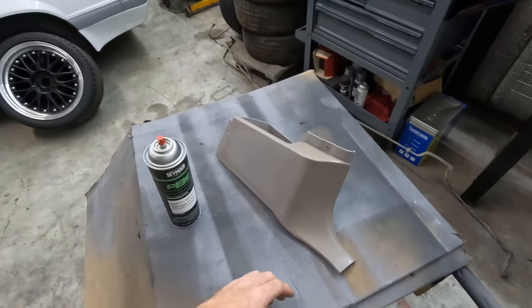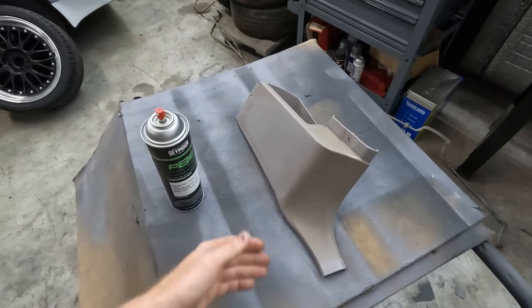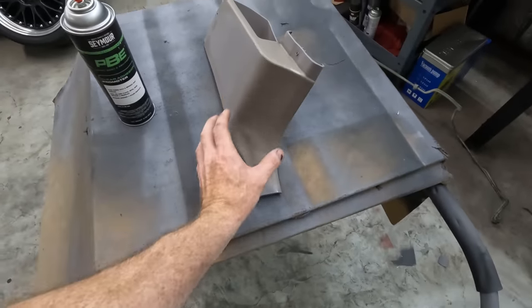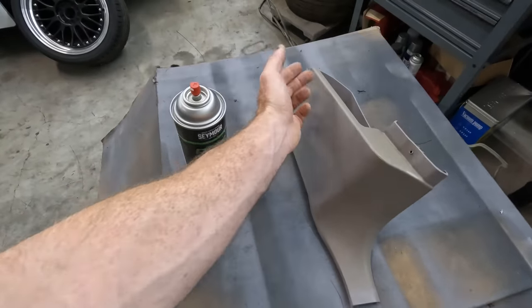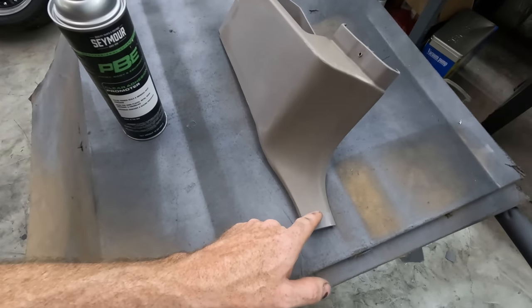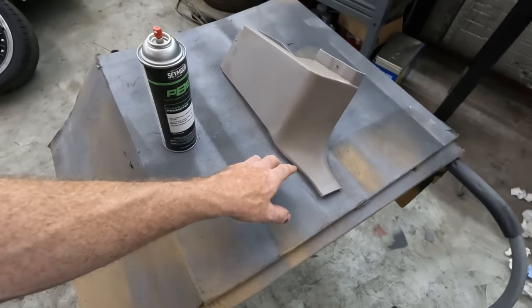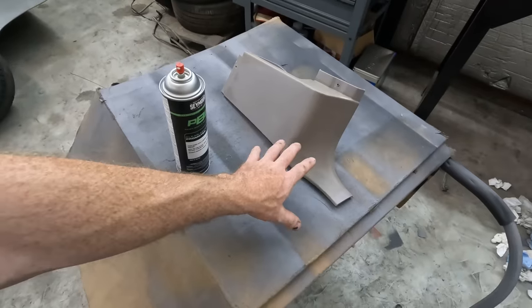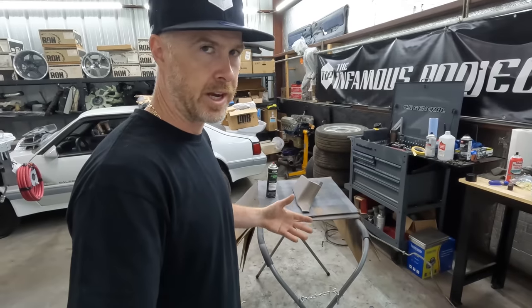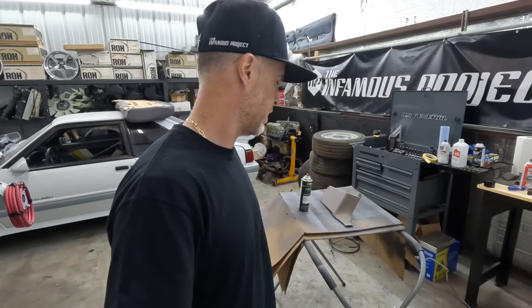This came out of some parts that I had, and this is a light titanium gray, which, just going back to the point of shades and variances, you can see here, this is most likely sun damage fade right here. The rear seat would have protected where that rear cushion is, would have protected the side here, and the door sill plate protected this. So, you know, this has all been cleaned and prepped and wiped down and scuffed and everything else. So it just goes to show some of these grays, how discolored they actually get. Whatever Ford used in terms of their paint or their dye in their plastics clearly didn't have proper UV protection. So it's a really tough one to overcome.